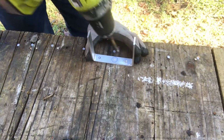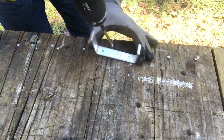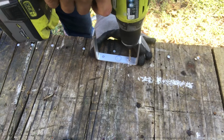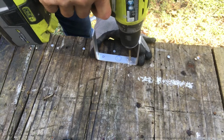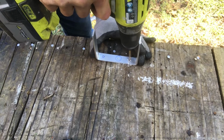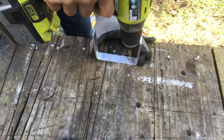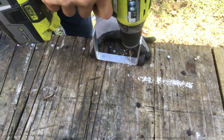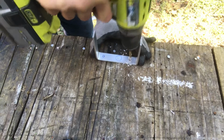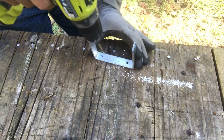when you drill the hole like this, you don't want to go at very fast speed, okay? You go slowly. You go with a slow speed. This is aluminum, so it's very soft. So it goes through very easily. If you go fast, all you do is create a walking drill. Okay, you go slowly with pressure, and it'll go much better than if you go fast. Okay, there you go. The holes go through right in the middle.